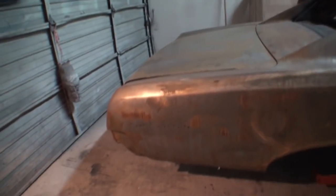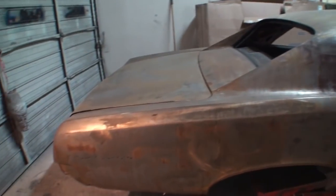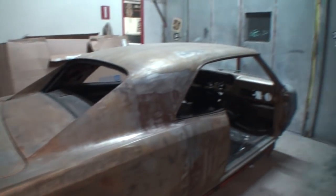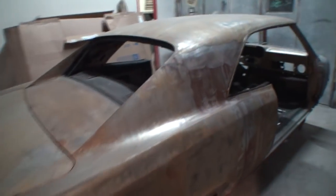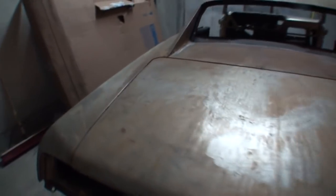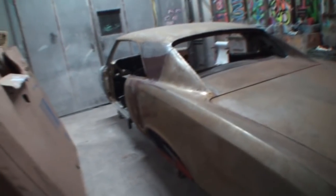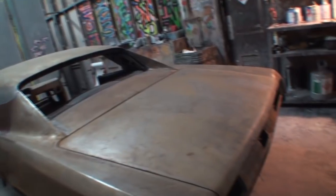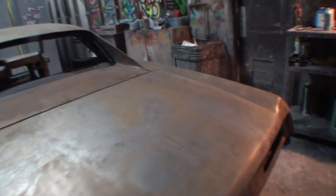The car is not rusted out — don't look at it like it's rusted. What you're looking at is vinegar water that I haven't removed. When you wash your car with vinegar water, it leaves a gold tint like that. This car was soda blasted and it's not rusting. This is just from cleaning the rust off and I haven't DA'd it down and removed it yet. We just got done doing this and we're letting it dry.